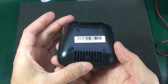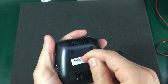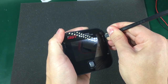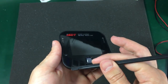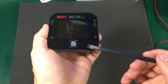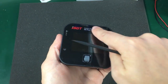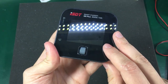I'm not seeing any screws on the back. I've looked under one of these rubber feet and under the label — there don't seem to be any screws, so I'm guessing it's just the screen being held on with clips. I'm going to try to get in through this side. After poking at the sides with a spudger I wasn't able to open it, and I think there are some screws holding it together but they might be under this black plastic cover. So I'm going to try to heat the glass surface with some hot air and separate this top black plastic cover — hopefully I don't break anything in the process.